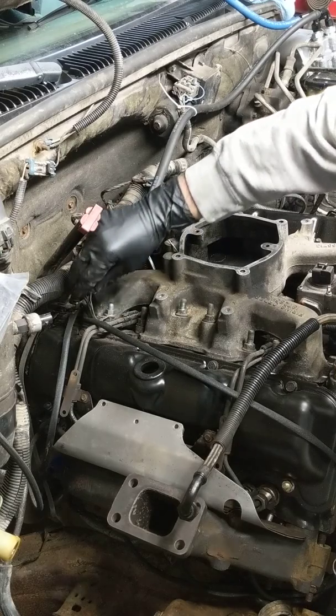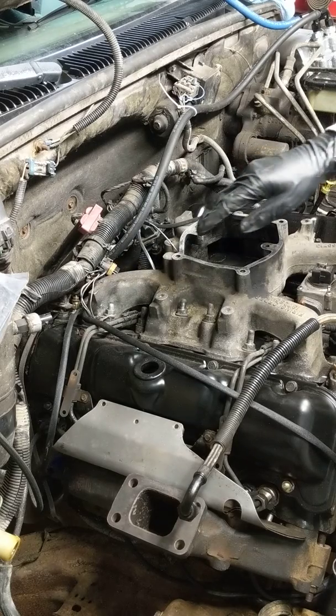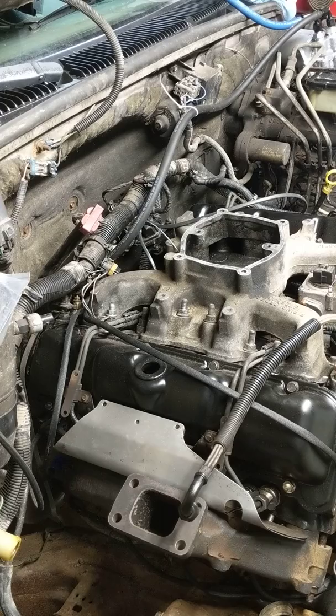Got a nice firm connection there. Everybody's happy — there's no stress on our harness, and we're good to go. Now we don't have to worry about any connection issues. You might also have them connected to intake studs, so clean those up for the two battery cable grounds that go straight to the intake manifold. Put the battery cables back on. Or if you notice any distress in the battery cables, it would be a good time to upgrade to our zero gauge kits. With these 22 to 1 compression motors, you really can't have too much battery cable. Get the electricity flowing, get the good grounds, and everybody will be happy. Thanks for watching.